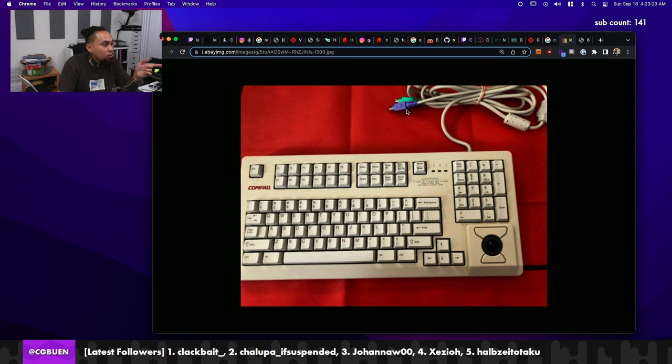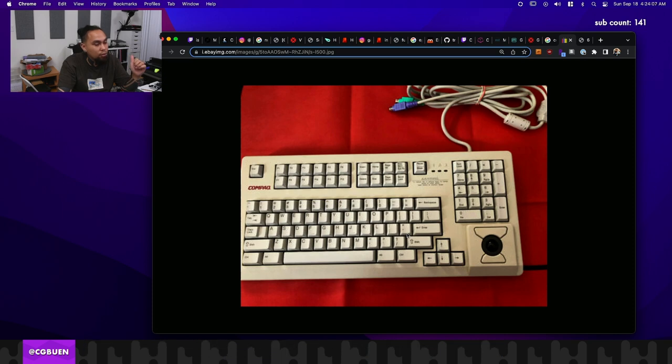And so this is not particularly useful unless you have a rear IO in an actual PC machine that can take these two. But there are adapters for this. A singular PS2 to USB active adapter will work for just the keyboard portion, but there also are adapters that take a dual PS2 and output into one single USB, and those, which I do have and can include for this type of build, will actually make the trackball work along with the keyboard. I find that really cool, and on mine, it actually is working, and that's really exciting. That's one factor of this.